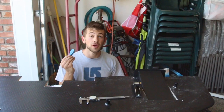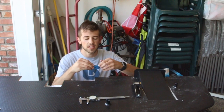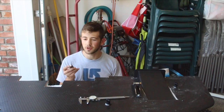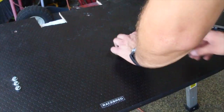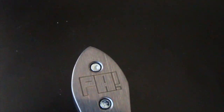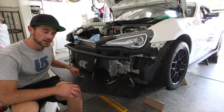For the last modification — installing the titanium skid blocks — I put a piece of painter's tape on top of them and marked the distance of the holes, then took off the tape and placed it wherever I needed to drill the holes on the splitter. I mounted the skid block as far forward as possible without the attachment screws extending past the front bumper. You will need to buy screws separately — there are three slots and I recommend getting all three; the screw size is 1/4-20. Another popular location is the edges of your splitter on the sides, so if the sides go to hit the ground, the skid blocks hit first.